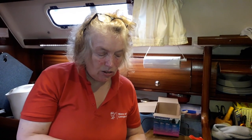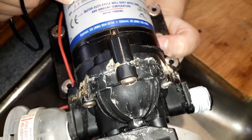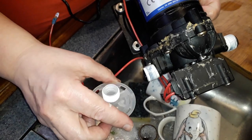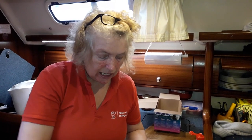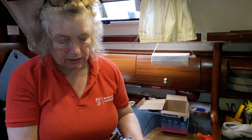The old pump is certainly crusty enough. While watching, I saw a couple of drips coming from this seal — you can see stuff has been coming out of it, so this is clearly what's been going wrong. It could well be the seal. We've got a filter here so I'm going to screw that off — we want to clean the filter and put it back on — but we'll need some PTFE tape.